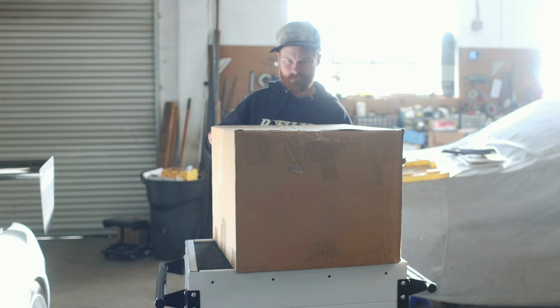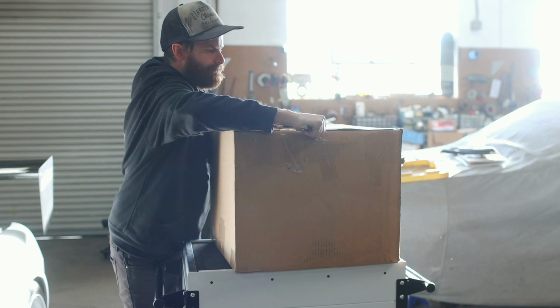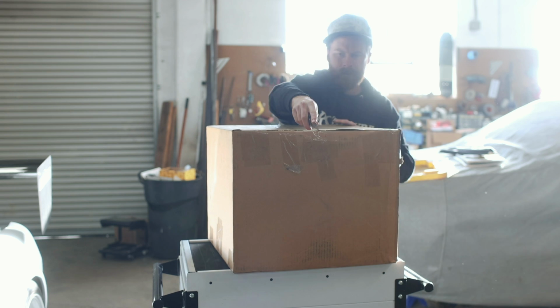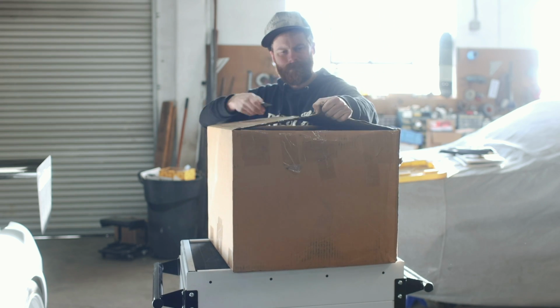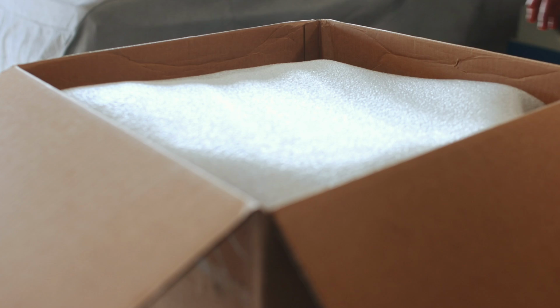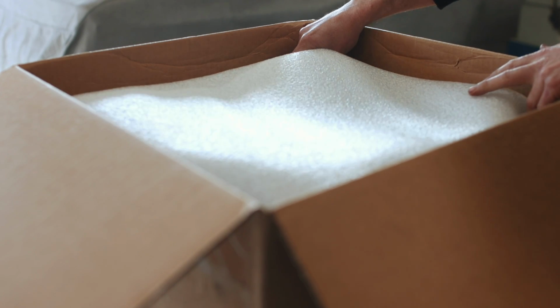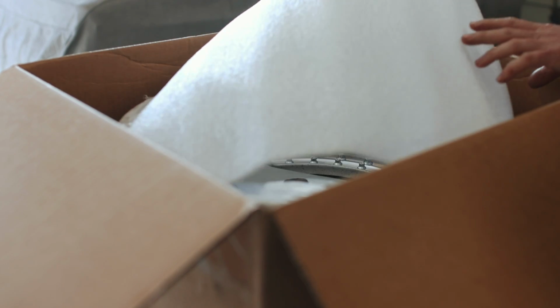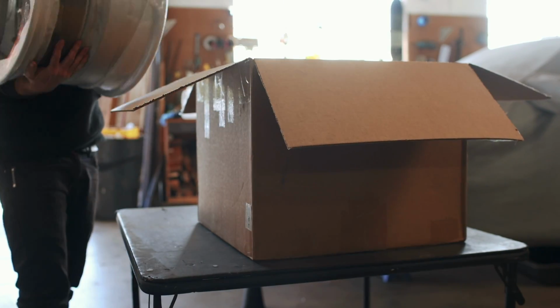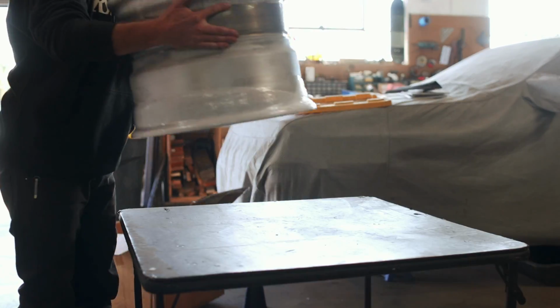I spent months deliberating what wheels I truly wanted to put on the Ferrari, and then months more tracking down the right set. Over a year ago, I sent these wheels out to have them cut apart, as they were originally a two-piece welded set. I had custom halves spun to step them up to 17 inches in diameter, and had them widened out to 12 inches wide in the rear. But this wasn't without a number of hiccups.